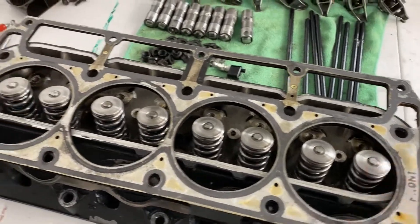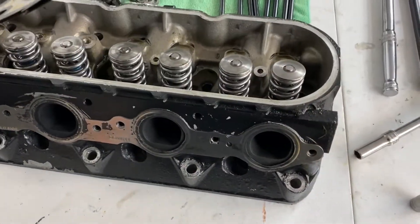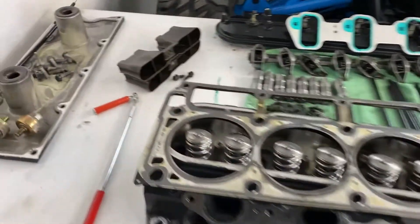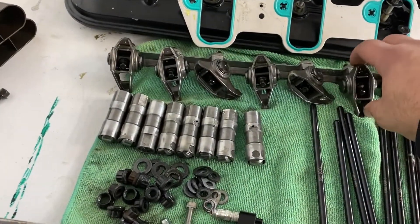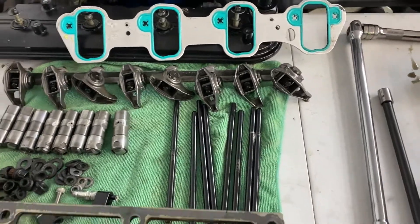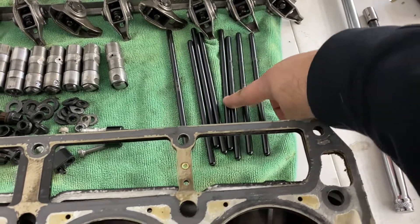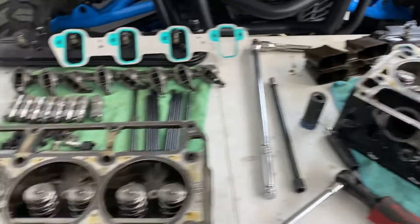Not sure if I'm going to upgrade the 660 dual springs to something like BTR — I don't know how crazy I need to go with this motor since we're not getting a ton of horsepower out of it, but I've got to look into it. Rockers look good. I am going to order the upgraded trunnions for these — I'll have to press those out and get the new ones pressed in, no big deal. Push rods look good — these are chromoly aftermarket. So stay tuned and I'll post up the next video once I get those parts. Thanks guys.